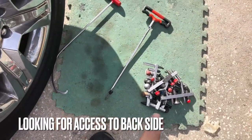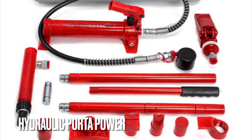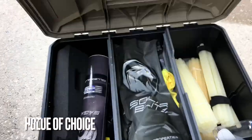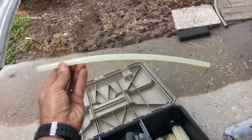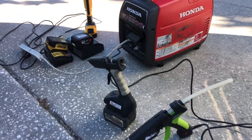We eventually are going to have to get to the backside of the dent with those two tools. We're going to take these Torx screws out, and that's going to reveal our access holes to get inside there. We're going to use a port-a-power — preferably a four-ton port-a-power kit — with some hot glue and some wooden blocks to basically relieve some of the stress on the dent. You can see our hot glue guns are firing up and getting ready to go.